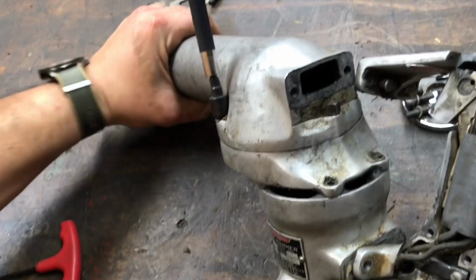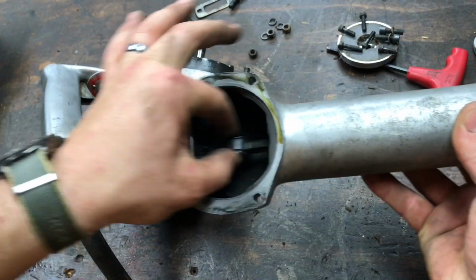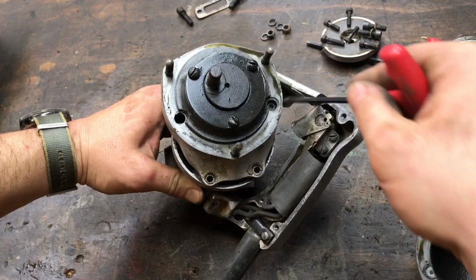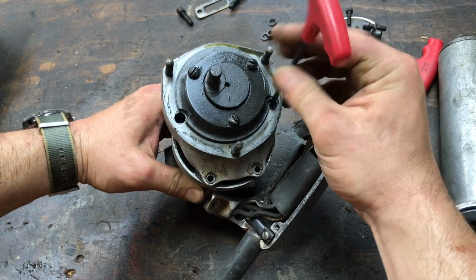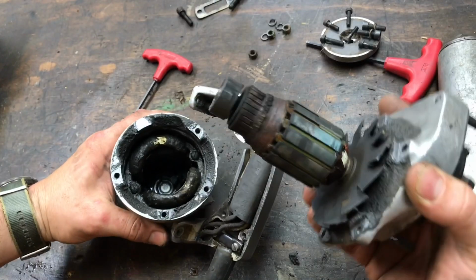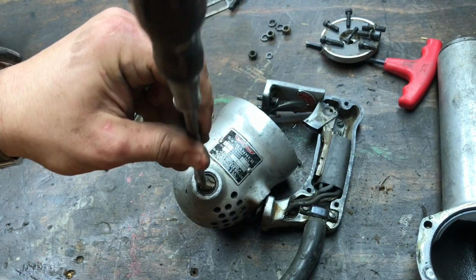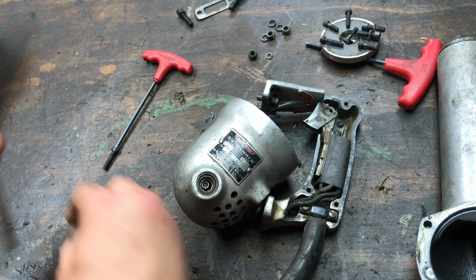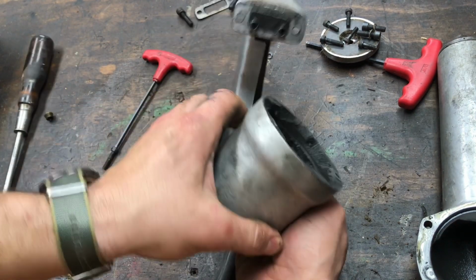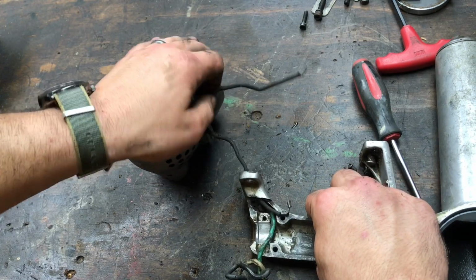Now, like any other restoration, we're gonna take our machine apart, taking close notes as to what screws and fasteners go where. And take a look there, you can see there's a stud off the middle of that motor that causes an eccentric that converts the rotational force of the motor to a linear striking force for the hammer end. Now we're going to take this motor apart. There's one of the brushes, and we're going to get everything nice and clean.